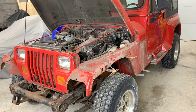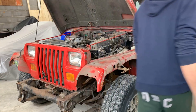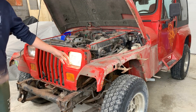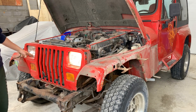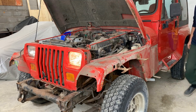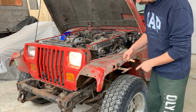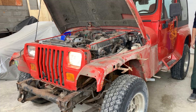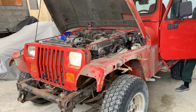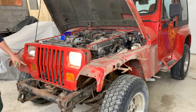Let's check first what works and what doesn't. We have the ignition on and the parking lights on — nothing is on here, we have one tail light working. Now here — is this high beam or low beam? I'm not sure, but here we just have a parking light. With the signal switch, we have a left signal working on one side but missing on the other. For the right signal, we have absolutely nothing — this wire is broken.